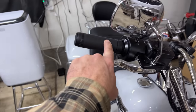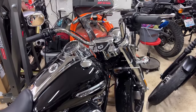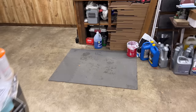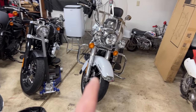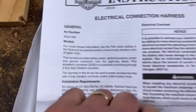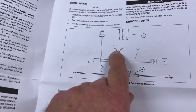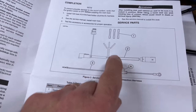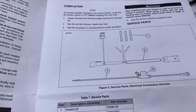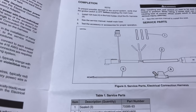It's the same grip kit - exactly the same kit that was on my '15 Street Glide, my '17 Street Glide, and now on the Road King. In the connection kit there's been an update - the part number is the same but there's an 'A' added to the end. What the update is: where you have these three wires - a ground, a 12 volt, and a keyed hot - there's a hot all the time and a keyed hot wire you can put accessories to, and you have this four-pin Deutsch connector.